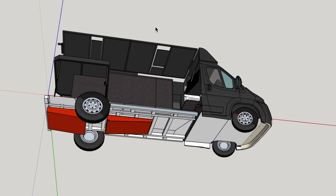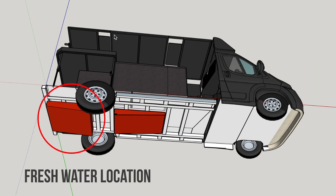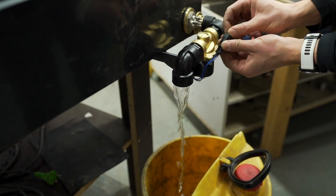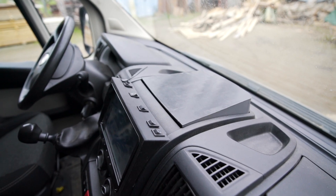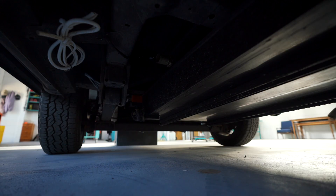We want to have the gray water between the axles — between the front and rear wheels — because that's where we have the sink and showers, so super easy piping. We took the spare wheel out and we're going to mount the fresh water behind the rear axle. Both tanks have a release so they can be emptied and winterized, or when going on a really long drive we didn't want to be lugging 150 kilos of water. The gray water release is on an electric ball valve with a switch at our dashboard, and we also put a nearby camera and light so that when we decide to dump our gray water from the cab we can see exactly if we're over the canal.